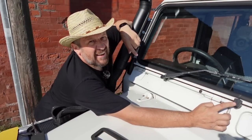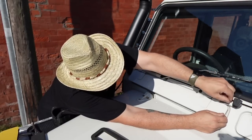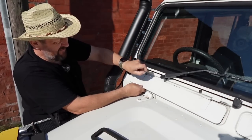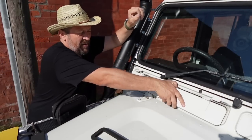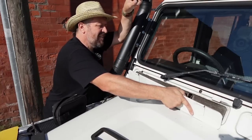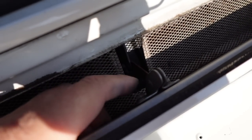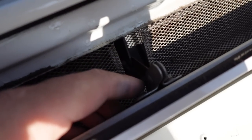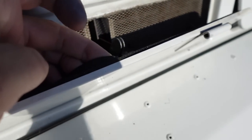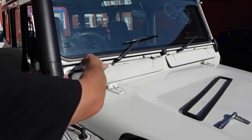We're not doing the washer jet just yet, but if you push — slide this out just enough — you can see it's now free. This one's going to come all the way out — there we go — and now we're free. You're going to want to open your vent flaps fully. Under here you can just see there's an arm. If you need to remove these, there are two bolts that go into the captive nut on the vent itself. We don't need to do that, but we can see the old foam in here which we're going to remove — just pull the old adhesive off.